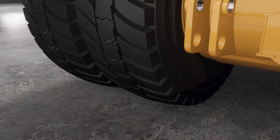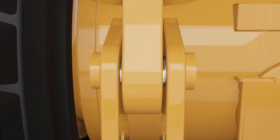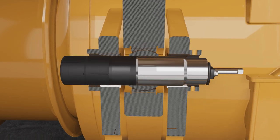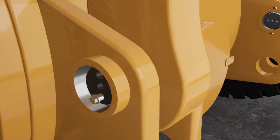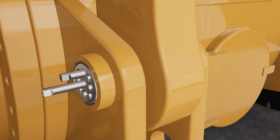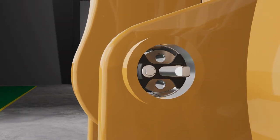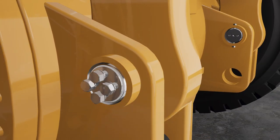Position the strut between the housings. Install the pin starting from the centre of the truck and leading the fitment with the guide sleeve. The polymer spacers will be pushed out as the pin slides through the bores. Use the alignment tool to remove the guide sleeve. Install the first collet on the tyre side of the arrangement. Centre the pin by pushing or lightly tapping the other end of the pin until the positioning plate is hard against the split sleeve.